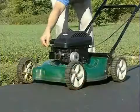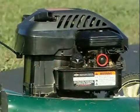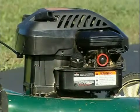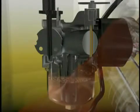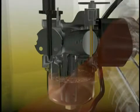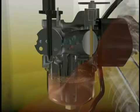The throttle plate position of a lawnmower engine, running steadily at a top no-load speed, is almost closed. Only a small amount of fuel and air is needed to generate the torque necessary to overcome the internal friction of the engine and keep the mass of the blade moving.